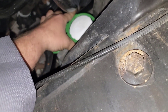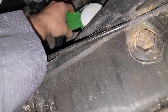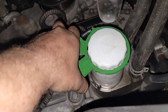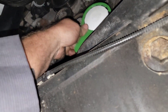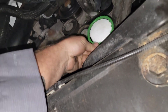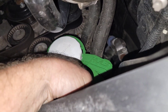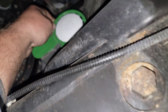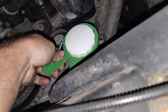If I ever got into a tight spot where I needed the handle to be stationary, I could push into it and just pull the bottom only. But in a situation like this I can just use the whole tool. I'll show you — if I had something to push up against or it was more stubborn, I'd go like this with the JM3 up against that hose and move the handle into it. Now look at it — it's rotating the filter, especially one that's really stuck.